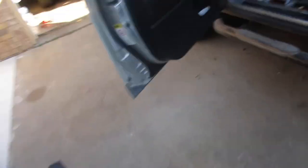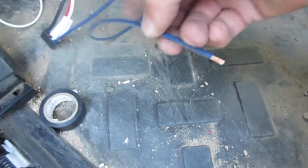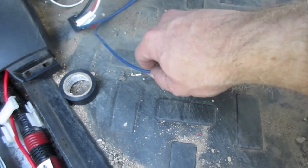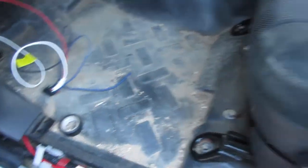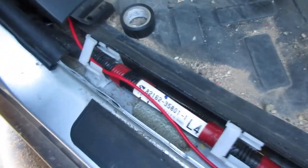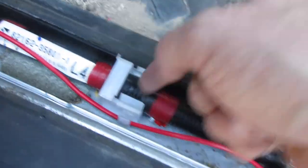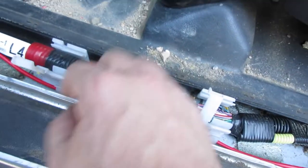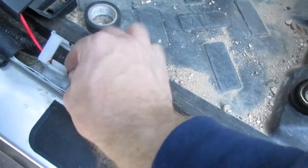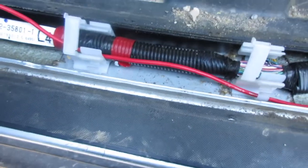Now I'm going to get my black wire and connect it to my blue here — I'm just going to treat my black as blue running back, connecting blue to blue back there. These little clips here, you just take a flathead and pry that and it'll pop open, and now we can run that inside right next to this harness, then clip that shut. Good to go.